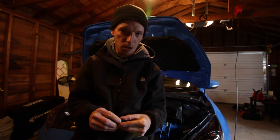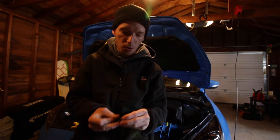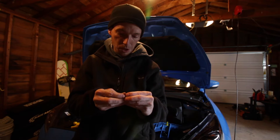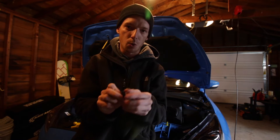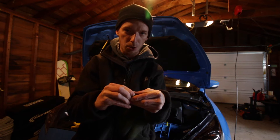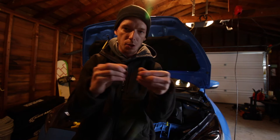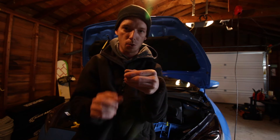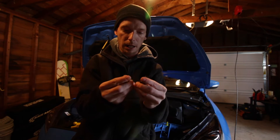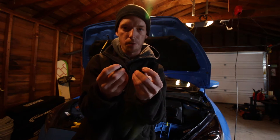These bushings are from Your Little CNC Shop, which I've dealt with in the past and linked before — I will provide a description below on where you can get them. They're a very good price. The key differentiator is that this bushing is a press fit bushing, where other bushings just slide together and rely on tension to hold them. These actually press fit, so once pressed together they will not come apart. That's a clear advantage, plus the black anodizing means we're not going to see any oxidation from these parts.